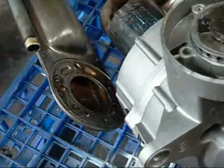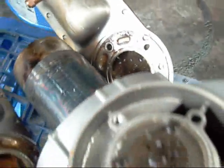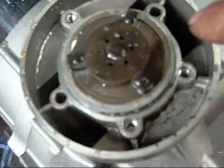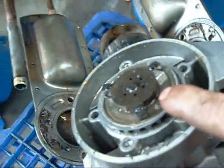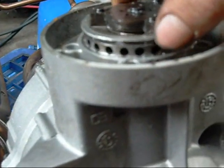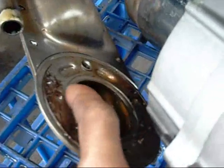Okay, well the mufflers are off, and you can see these passages in here are the suction side — the low pressure side. And this reed underneath the discharge valve assembly is the start of the high pressure side. This aluminum washer simply separates the two when the mufflers are clamped on.